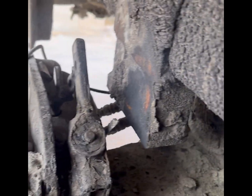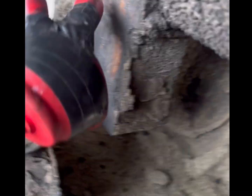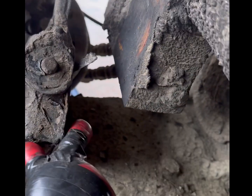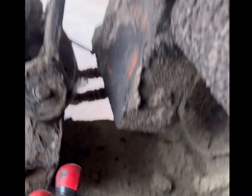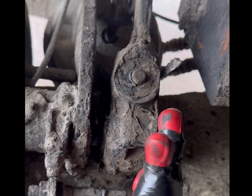So one of the things that happens here is whenever these bushings down here loosen up, these two bolts loosen up, or you bust a spring or whatever, these axles start moving back and forth a long ways. And this stop right here — if you notice where something's been rubbing there — the axles shift over and the S-cam slack adjuster here will ride against here.